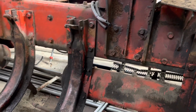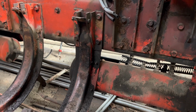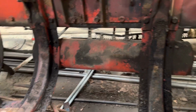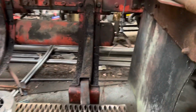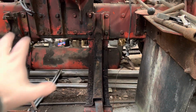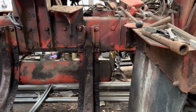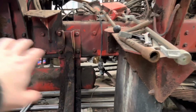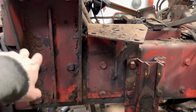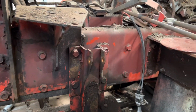A friend of mine has done me some tanks as a favour. I've swapped him some old car parts I had. So they'll make an appearance in the next video. I won't be fitting them though. I'm going to take all these brackets off, sandblast them, paint them up, make them nice. Do the same to the chassis. This area obviously won't be accessible once the tanks are in. So I'll pull these brackets off, sandblast the brackets, wire brush the chassis, and get it back to bare metal.